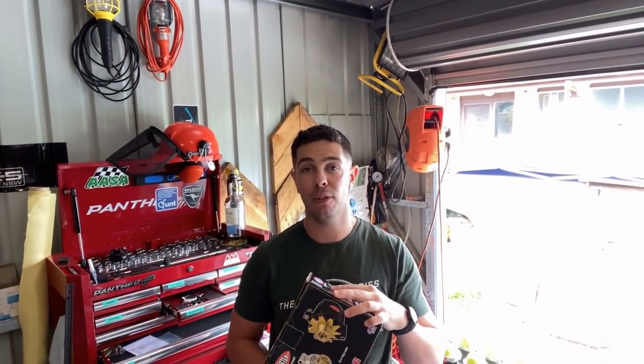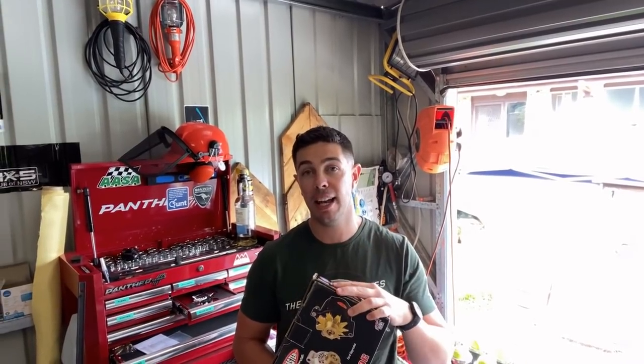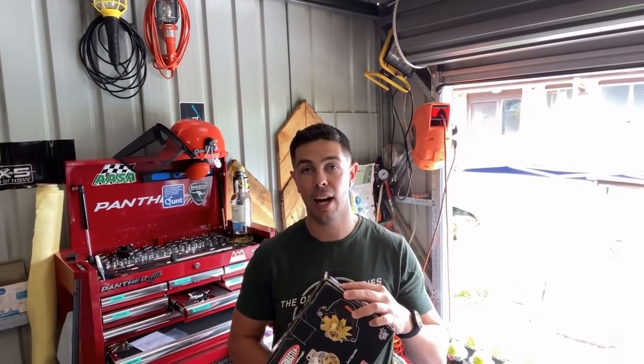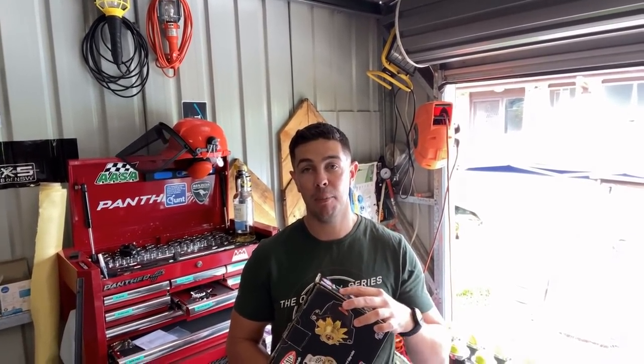I've also had my alternator turn up. This has been a bit of a saga, just trying to get one that would do the job in terms of having an idle output amperage that was sufficient to drive everything, but then balancing that with not overspeeding the alternator at its red line. There can be a bit of an issue there, apart from warranty.